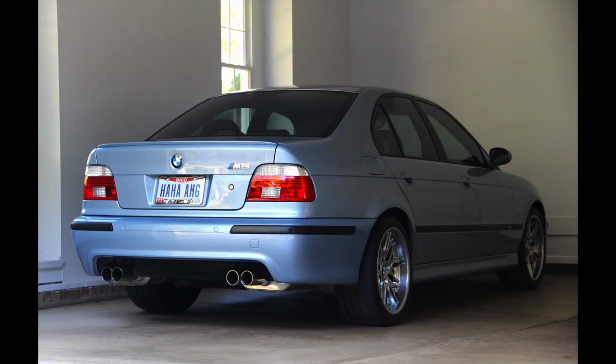Now, this next clip is a little scary. I actually wasn't there for this. The owner of the shop texted me a video. So they got the engine in. They checked the oil level, all that, put power steering fluid in it, had the coolant ready to go, and then pulled the relay for the fuel pump and started to crank the engine over to prime it for start, let some oil move around, get all the moving parts moving. I wasn't there for that.